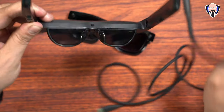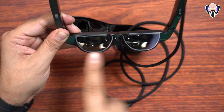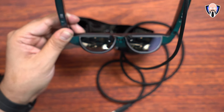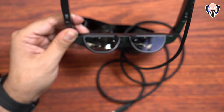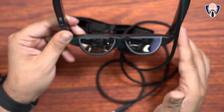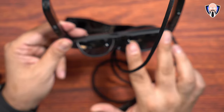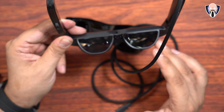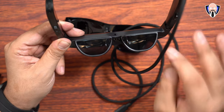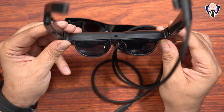We have two displays in here — one and two — basically reflecting off of a mirror inside. The reflective material allows us to see these displays. There are two micro-OLED displays present, with a 16:9 aspect ratio and about a 47-degree field of view — a very nice large display running at about 60Hz. When running in 2D it's 1920x1080p, and in 3D it plays at 3840x1080. It's considered a bird bath type of display optics.